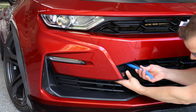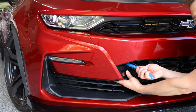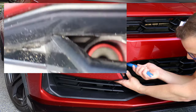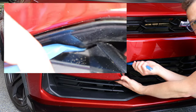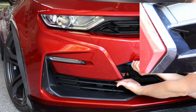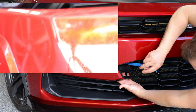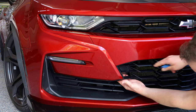There is a small slot that you will see here — I'll put a close-up of that on the screen right now. What you want to do is put the panel removal tool, shove it in there, and pry upward to push down the tab while at the same time pulling down on the latch at the bottom. And when you do that, it's going to free the grille up and allow you to pull it out.